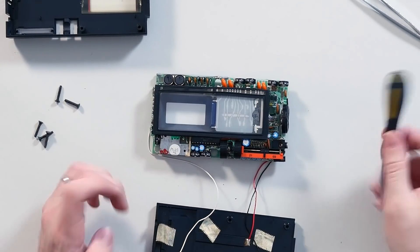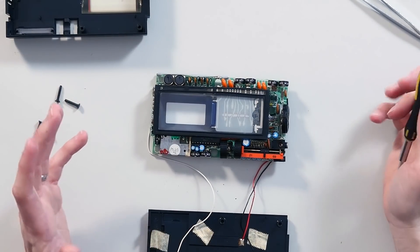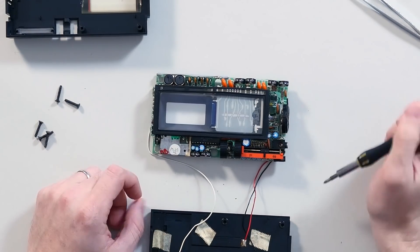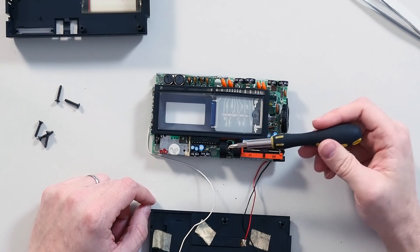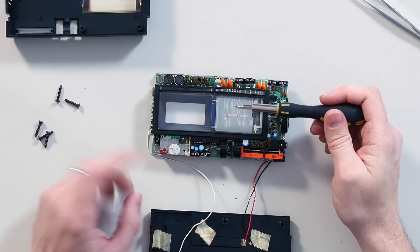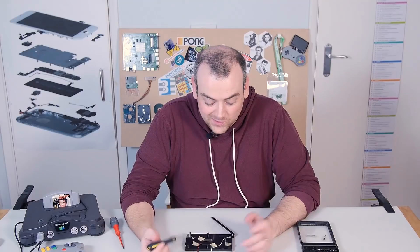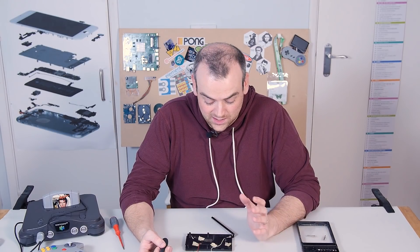Let's talk for a minute about the electronics. We found this little integrated circuit which is essentially a TV on a chip — all the rest of the board is just the passives and interactions. You've got headphone output, power input, volume and power switch, and tuning, plus pots for CRT calibration. I thought this was essentially broken, but clearly it wasn't — all it needed was that chip re-seating in its DIP socket. With the right inputs, it now works. Which is awesome.